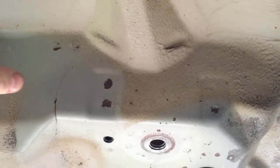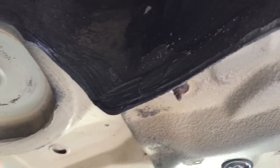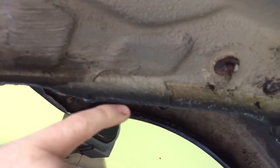And then on the other side, the left rear corner, now the dirt is off, that crack has clearly grown a lot further, or not grown, but it's obvious it's further than it was when it was just dirty all around this area. And then possible spot weld movement in that area there underneath the sealer. And quite a good sealer split all the way from here, all the way down up to about here, where it then joins up and goes vertical up on the inside slope.